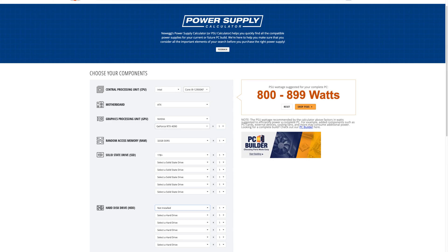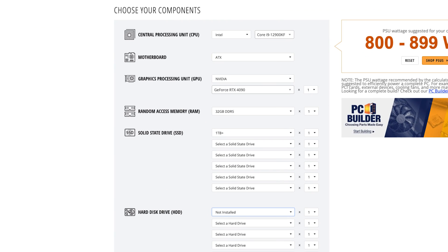The power requirements are mentioned in the card's documentation and website, but that's not the whole story. Those requirements are minimum estimates, not precise specifications. The available power for the GPU depends on how much power the other components of your computer need. Use a power supply calculator to get a more accurate picture of how powerful your PSU should be. Also, remember that GPUs have a specific wattage requirement and need sufficient amperage to work.